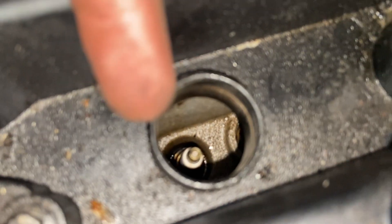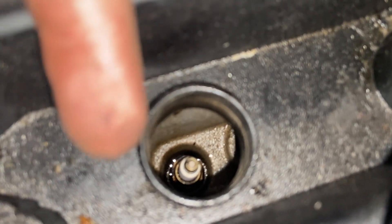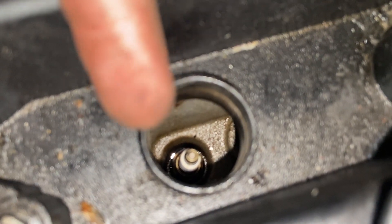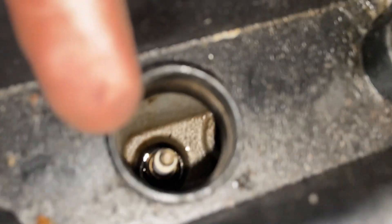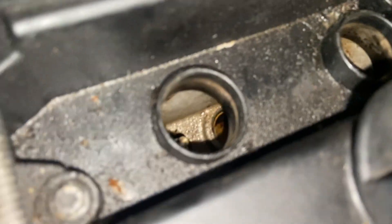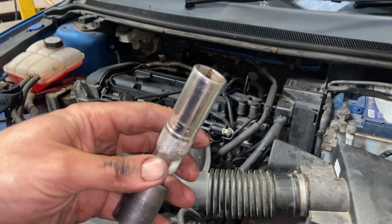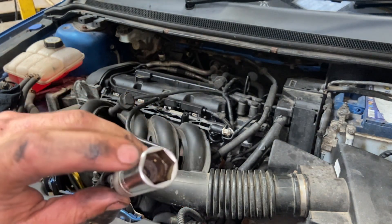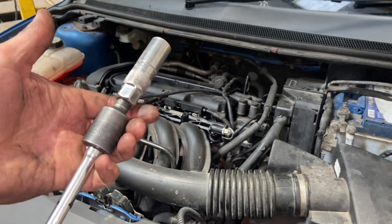If there is a lot of oil in there, just be careful when pulling the plugs out that you don't drop oil into the engine. It's a little bit tricky, but you may need to use a bit of rag or tissue to wipe out as much oil as you can first. There's only a little dribble in there for me today so it's not too bad. I'll undo them all now, swap them over, and run you through the torque setting. I've got a spark plug socket — there's a link in the description — it's got a rubber insert that grabs the plug as you undo it, making it nice and easy to pull out.